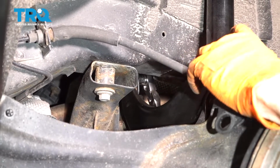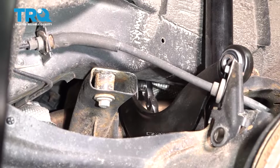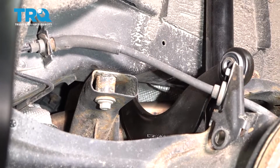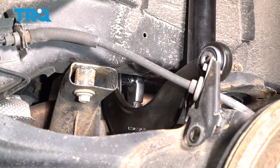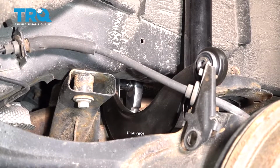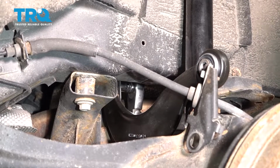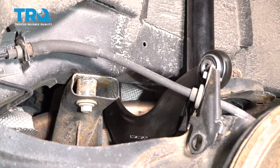Okay, once you snug it, control arm should stay. Let's switch to my longer ratchet and then make sure it's actually tight. I don't have a torque spec for this one, so just do your best to ensure that it's tight. If you wanted to put thread locker on the bolt, you can go ahead and do that. There we go. That's perfect.